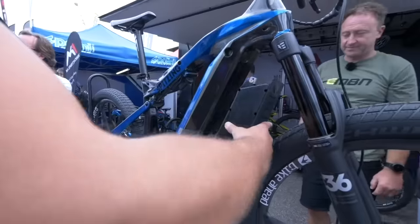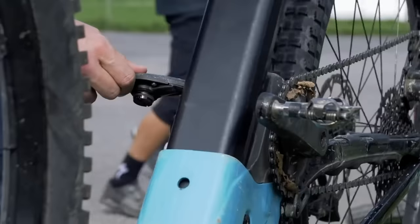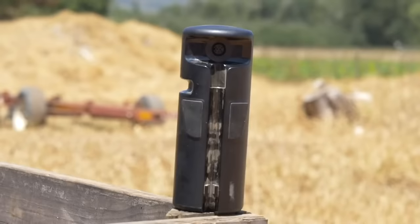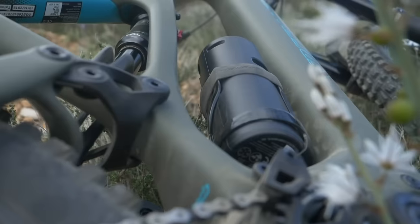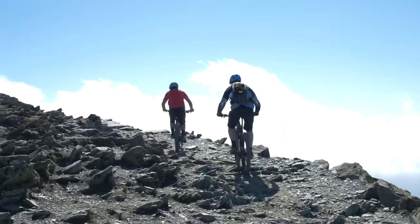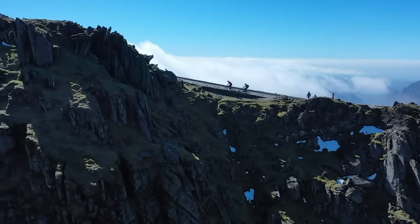Battery sizes are measured in watt-hours and range from 300 watt-hours all the way up to 900 watt-hours. You can also get range extenders — bolt-on batteries that can add up to around 500 watt-hours. A bigger battery will not add any more power to the bike than a smaller battery; instead, it increases the range, allowing the rider to cover way more miles.